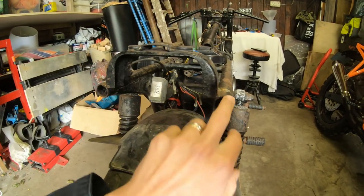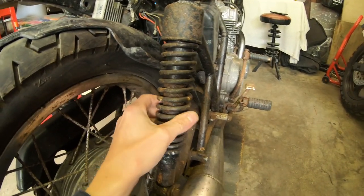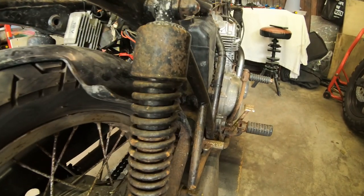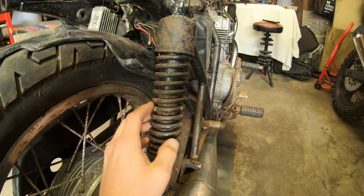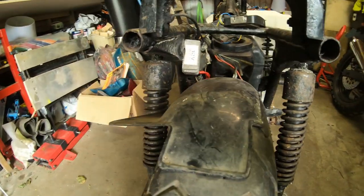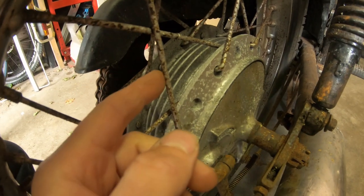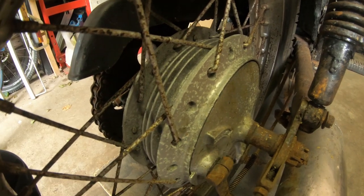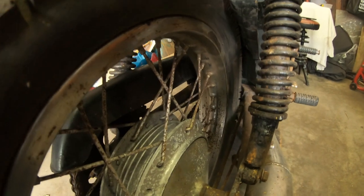So it's been chopped already. Perhaps someone was going for a cafe racer hump, which is why they left this sort of wishbone thing here. We'll probably take that off and weld some kind of hoop — either a flat one or a wee kick one like I've got on the XS250 — depending on tire clearance and what tires we're going for. As for the shock absorbers, they are beyond saving, beyond economical repair as they say. I quite like the idea of some Hagons on here — really good value shocks made in the UK, a good upgrade for this bike.